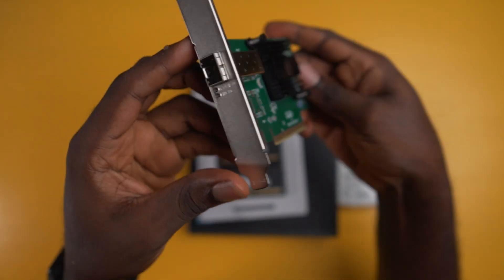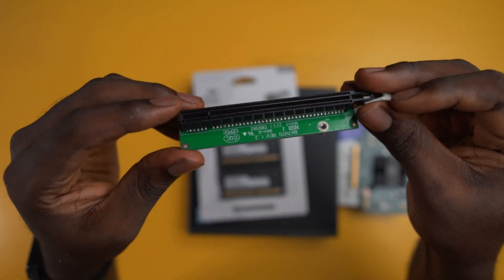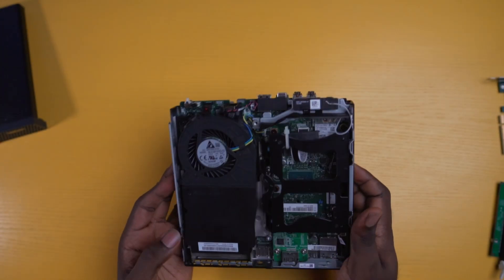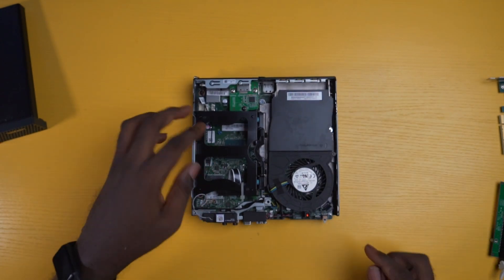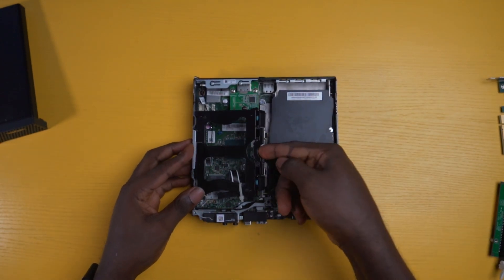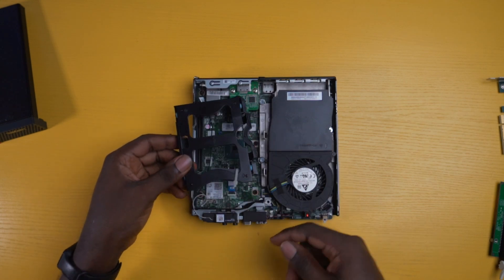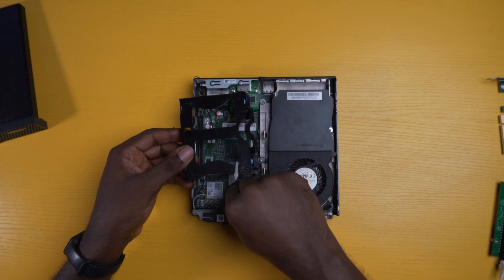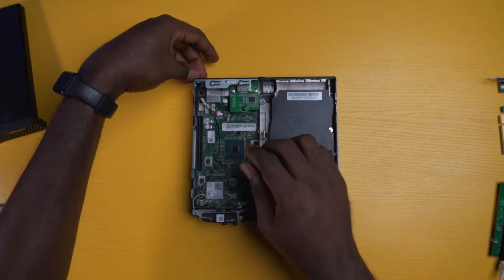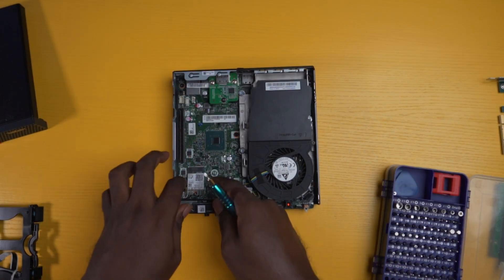The last upgrade to be made is the 10Gig SFP Plus with the PCIe x16 riser card. To get this done, we need to remove the 2.5 inch hard drive cage to free up the spot. Push the clip at the side of the storage cage to lift it up, then remove the connector flex cable from the slot on the motherboard. Since we will not be needing the Wi-Fi antenna, we might also remove the extension wire from the Wi-Fi card on the board.